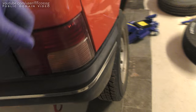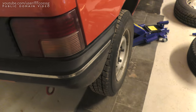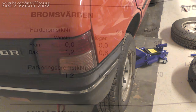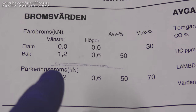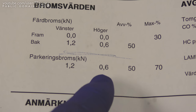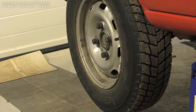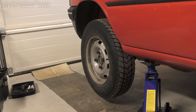Let's see if this wheel's locked — that's locked as well. Well, this wasn't as easy as I expected. I just dug out the paperwork and they do specify: the left rear brake is 1.2 kN and the right one is giving 0.6 kN, at both the hydraulic and the parking brake. So we've got an issue with the right one, and indeed it does seem that one's grabbing a bit less than the other.